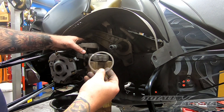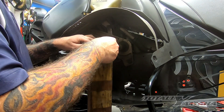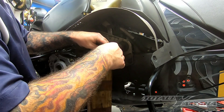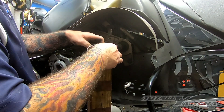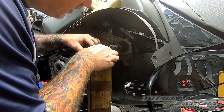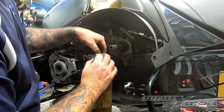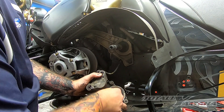Then I'm going to put in this snap ring. Basically it's the same thing as the other side — you just get one side walking in, then walk it right around. You want to have this offset portion up away from the bearing edge — there's actually a cutout in this race. You can see this dissipates the heat so fast it's already cooled down, and that's why that bearing was a little bit harder to drive in. She's all in there, nice and clean.